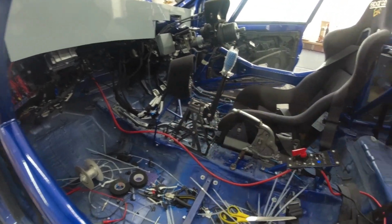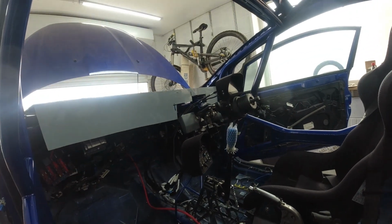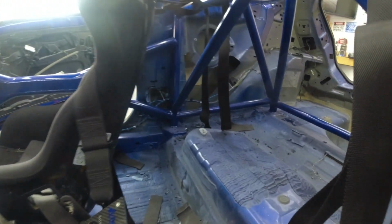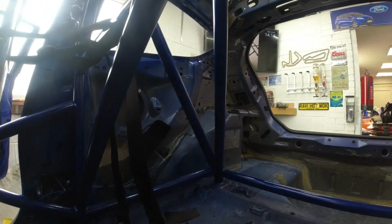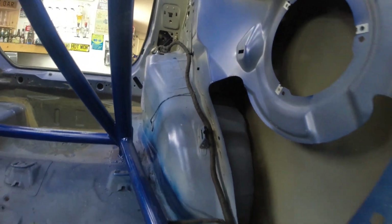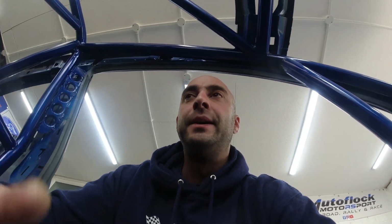Like I say, they're like PC connectors. Get the dash finished off, and that's it. I've also, what I've done is, look at the wiring on this side. I've not touched that side yet, but that's how Ford let them come out of the factory. And what I've done is I've loom taped on this side, so you can see it's so much neater. So I'm going to do that to the other side, and it's a bit more solid, and I haven't got to worry about nicking a little wire or something, as it's protected.